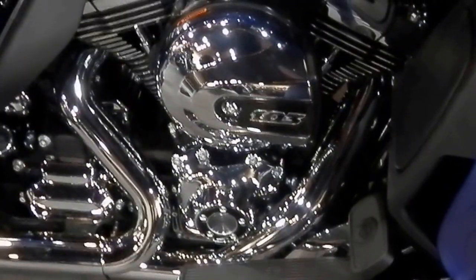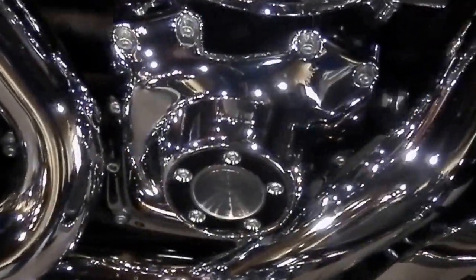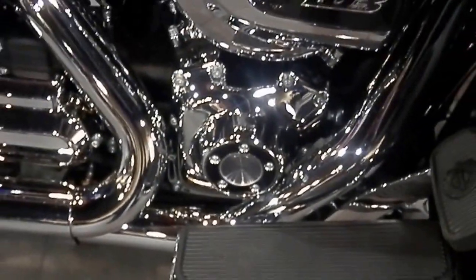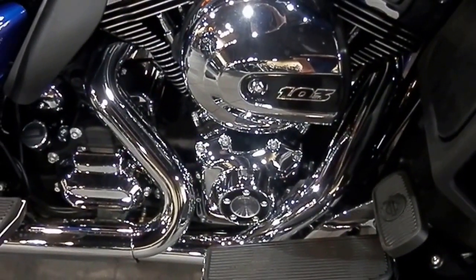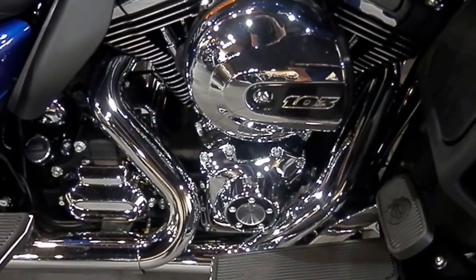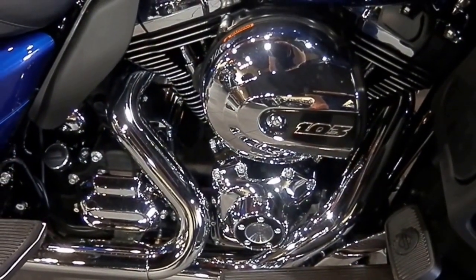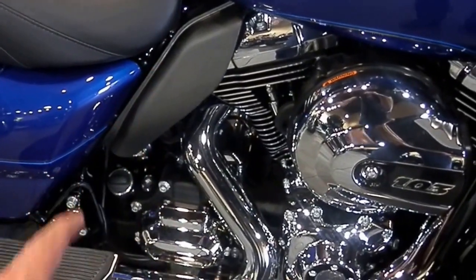Failure to do so can void your warranty. Harley's owner's manual and service manual does not tell you at what mileage interval you should inspect both cam chain tensioners — that's the problem; it's up to you, the consumer. If you don't get them inspected periodically and they do wear out — at 3/32nds of an inch of wear, or about 50% of the thickness — they have to be replaced. Otherwise they'll break apart, causing metal-to-metal contact, and the metal shavings are inducted by the oil pump into the crankcase and cylinders, resulting in immediate and catastrophic engine failure. You can see the heat shield is still needed for the extreme heat this engine puts out.